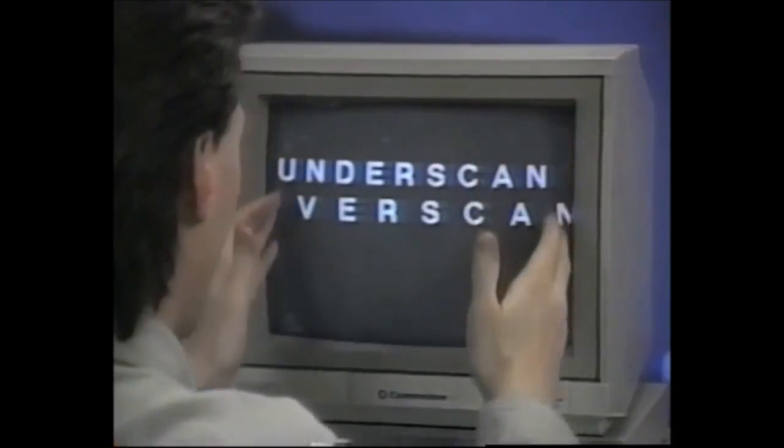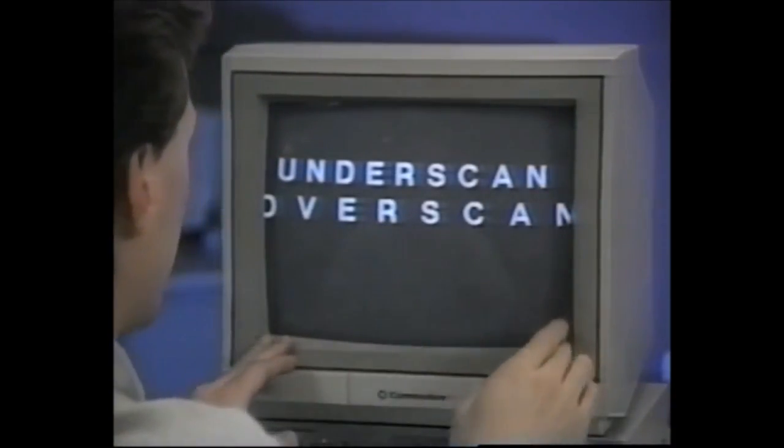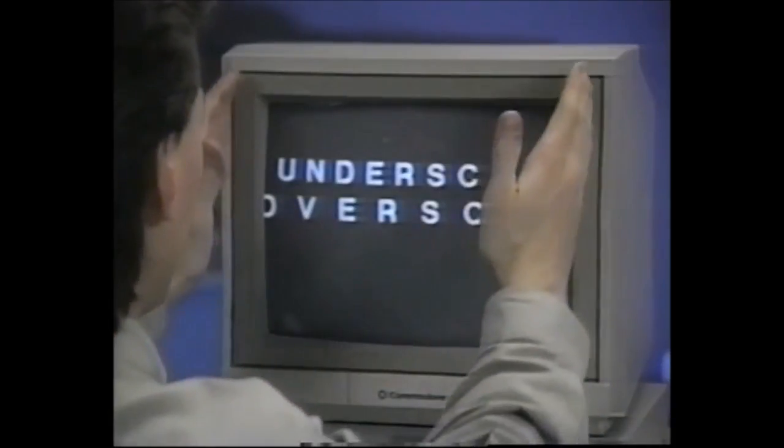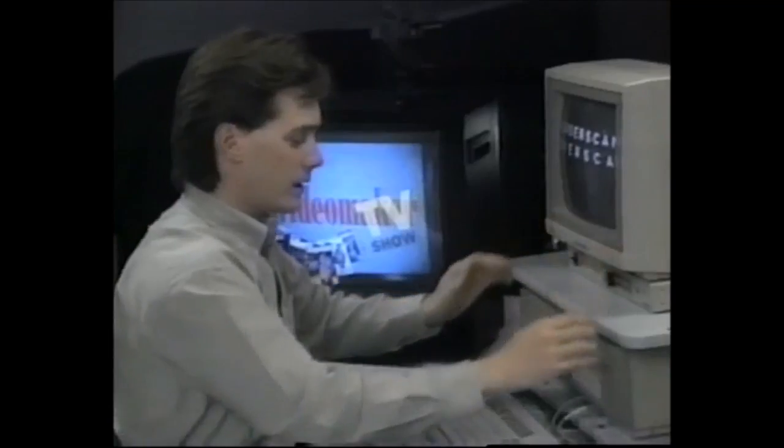Second, all computers but the Amiga output an underscanned image. This means the outermost edges of the graphic fall inside the borders of your monitor. NTSC video requires an overscanned image, or one whose outermost edges fall outside the visible portion of the monitor. Because of this, most Genlocks will have to stretch your image. This can change the proportions of your graphic dramatically, or make portions of it disappear completely.